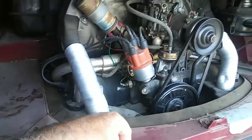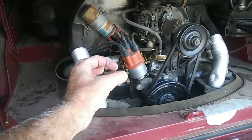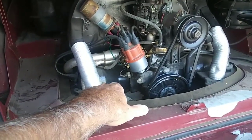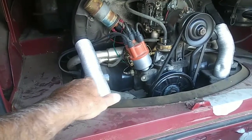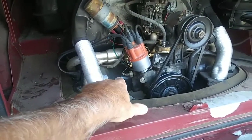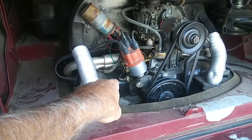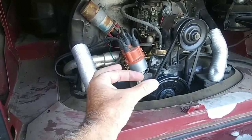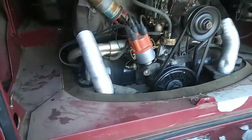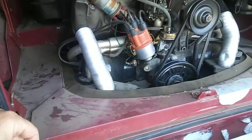The cool tin actually does work because they meter the amount of air going through your cylinders, which is not the hottest part in your engine. Your heads are the hottest part. Fire goes in the heads, not in the cylinder. So the cool tin meters the amount of air going through the cylinders and puts more air through the head. Putting more air through the head gets the head to run cooler.